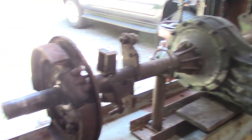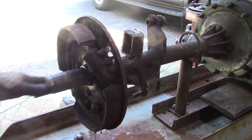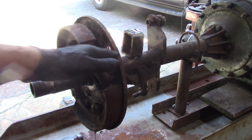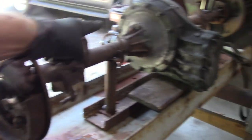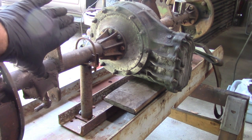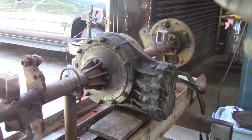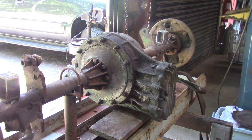And the other thing is, on this particular wheel, the wheel cylinder is at like 2 o'clock. And what I'm going to do is index the axle tube there on the flange. One rotation of the bolt pattern, and that should bring this closer to top dead center, similar to the one on the passenger side. So step one, cut all the brackets off.